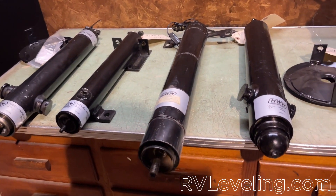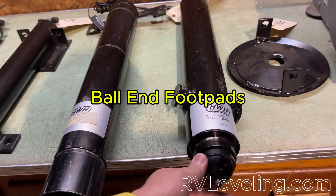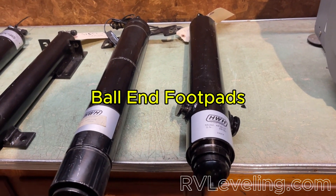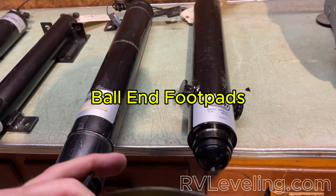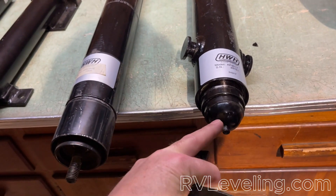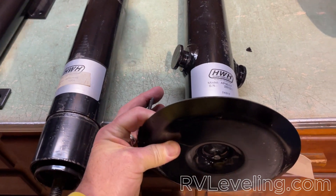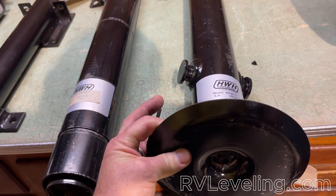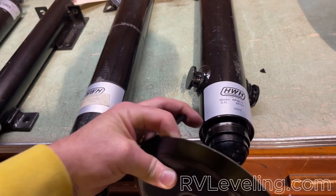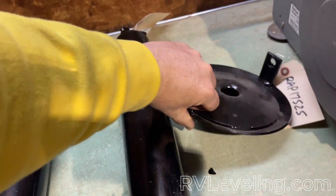The second biggest difference is that there are two styles of foot pads. The first we call a ball end or pivot ball end foot pad. They do not put new systems with this style on any longer for liability purposes, because these ball end foot pads are held on with the springs, staying under tension via the springs in the housing. If you hit a rock or damage a spring, snap a spring — they can break over time — it would cause the foot pad to possibly fall off, and you definitely don't want that flying off behind you down the highway.